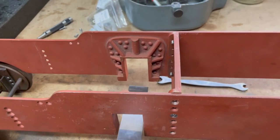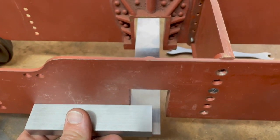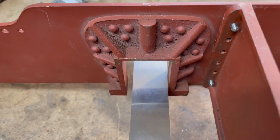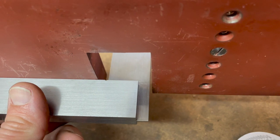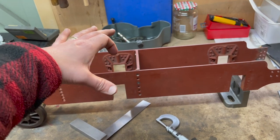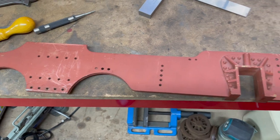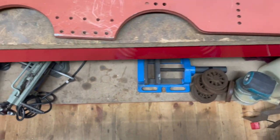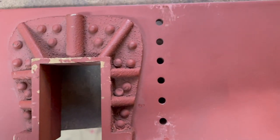On the first pass at this, I've got my machinist square and if I bring it up hard here you can see there's air there. I move it to the other side and it's now hard up against that slot with air on this side. What that means is the chassis is pulled around in that direction. The two frames are bolted together at the two corners and they look pretty much identical, at least as it refers to these holes here and these holes here.